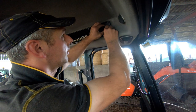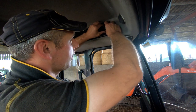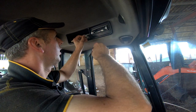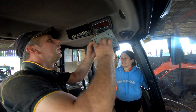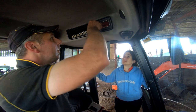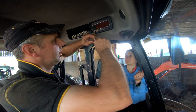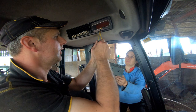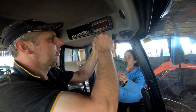Basically there's a little tab to either side halfway up, and you use these little flat keys to trip them so that it releases the mechanism — that's the idea anyway. But of course I haven't got specific JVC ones. Thought that we've got it. A bit of luck — we've got some ISO connectors here, got the radio, that was the aerial, just flip back in. And we've got two ISO connectors: one does the speakers, and this one looks after the power, ignition, that sort of thing.